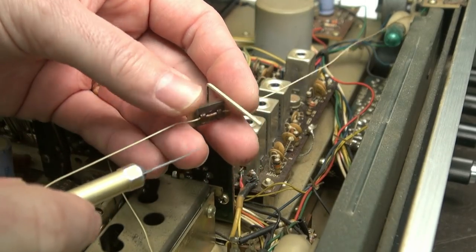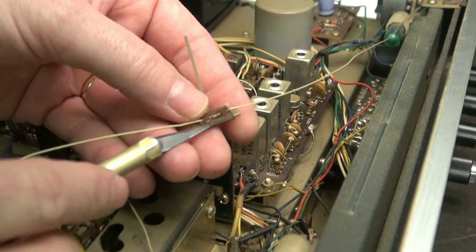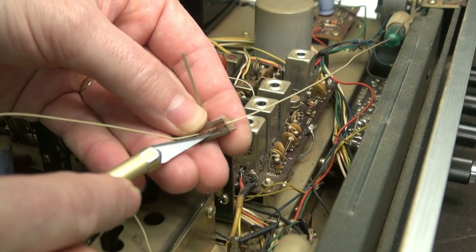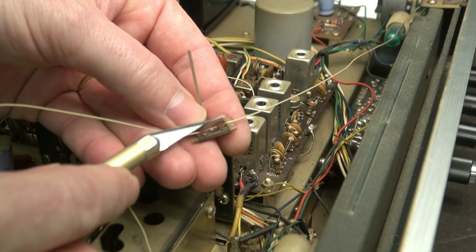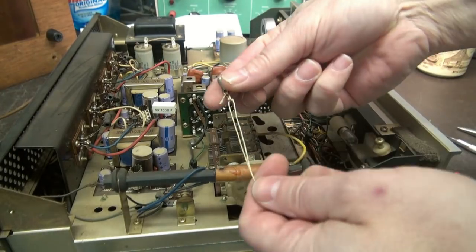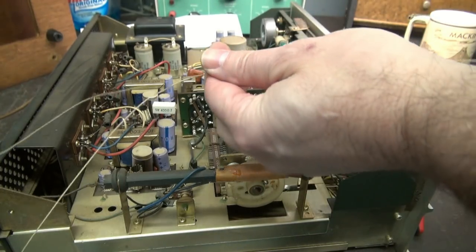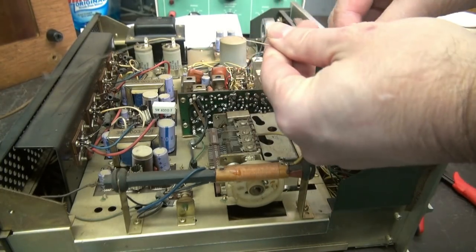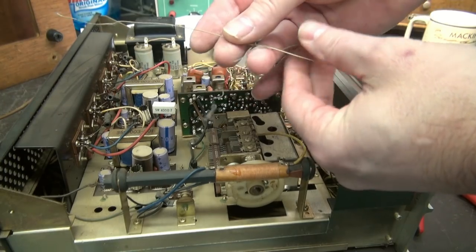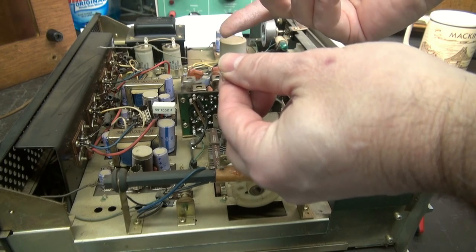Here's the tuning needle — they use more of that stupid glue. So take an X-Acto knife, get under there, pry up these tabs, and carefully get that string out of there. You don't want to damage this either. So here it is — the dial cord's removed, still got the spring there. And over here I went ahead and cut it where the bad areas were around that pulley. Now I'm going to measure this, cut the new black cord, and get her re-strung.